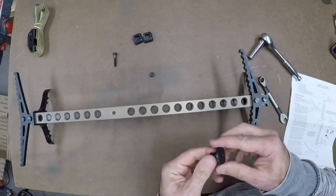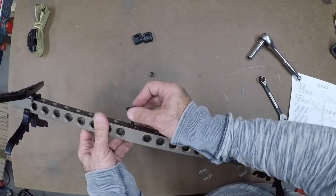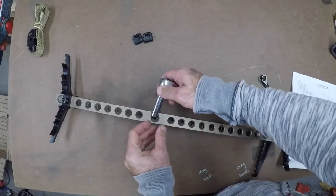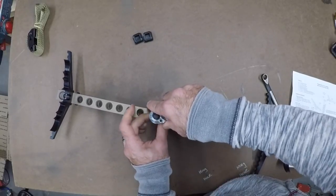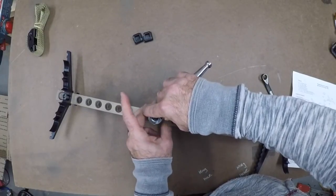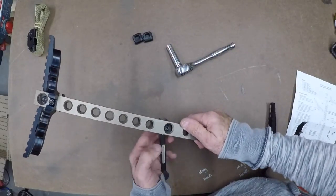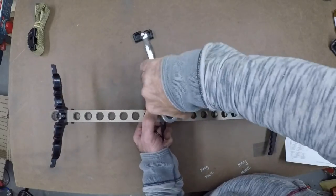Now the last thing left is the Versa button. We are putting a bolt through the hole, and it's going to go on the front here. This one might be a little tricky — got it right on there. It's starting to bite on the washer. Put the 7/16th wrench on the back side and hook my socket back up and tighten it down.